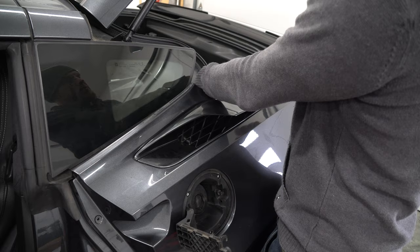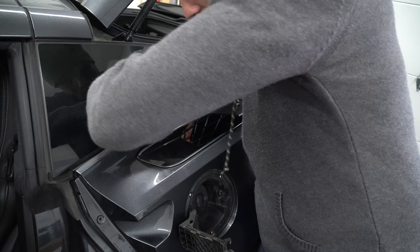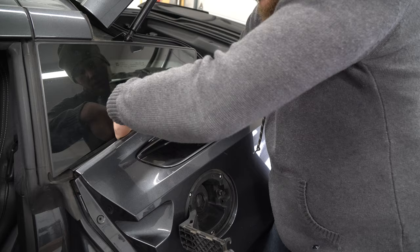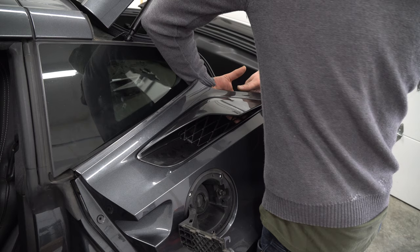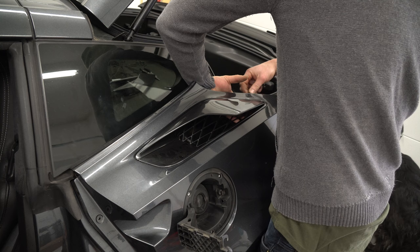This side — same way as you put it on. Just go in here, fingers wrapping around. Remember to turn it the other way this time for the nut. Once you do that side, you can even put the next nut in and go down. Bring the nut in through here, just like that. Tighten it just that much — I barely put any pressure on this. Do not start cranking on these nuts. If you do, you're going to crack that plastic.